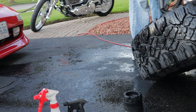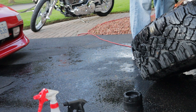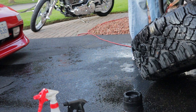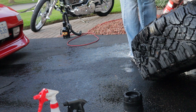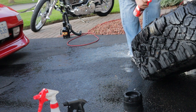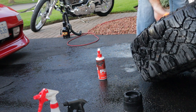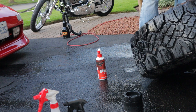My main concern is getting all the water off these wheels before I attempt to coat them - you do not want your coating coming in contact with water when you're applying it. I blew them dry, propped them up so water wasn't pooling into the cracks around the wheel, and moved them around to blow them dry from all angles. Best case scenario would be to clean them and have them sit outside in the sun before ceramic coating, but I'm very rarely working in ideal conditions.